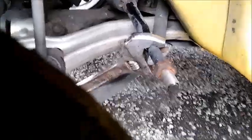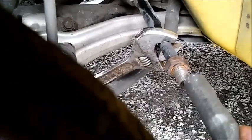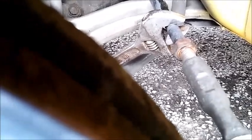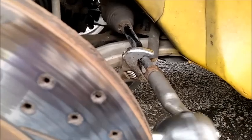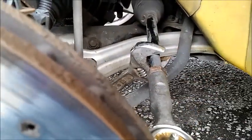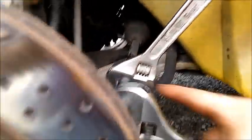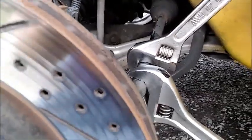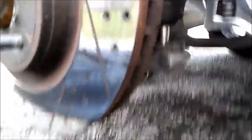So the original one is all wobbly and the new one — we put grease in the threads. This one's gonna seize down otherwise. Just count the number of turns and it should go back the same way since I barely moved that nut. Thread it right up to there, make sure those two lock nuts are locked together — the inner tie rod has grease and the threads come back off again easier.